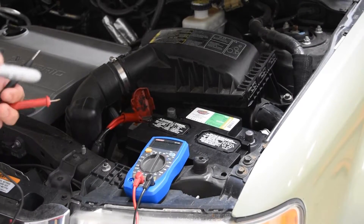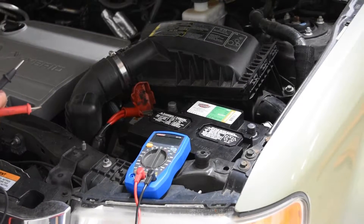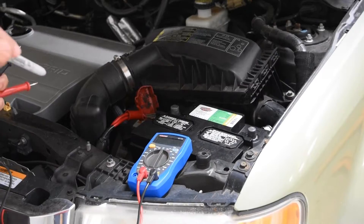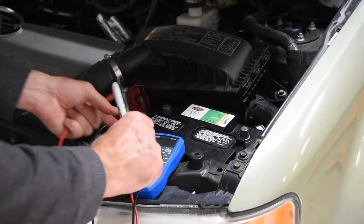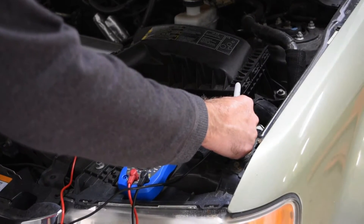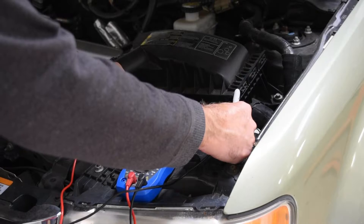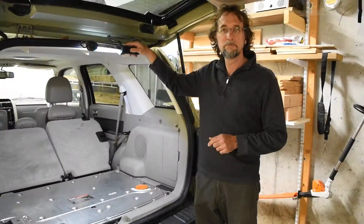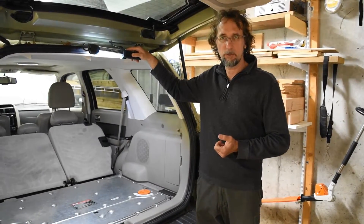It's a good idea to also check your battery that's in the engine compartment. This battery is not there to start the engine — it's just for the control units to get everything in the state that the engine can be started from the HV battery. Please disconnect the terminals before you do that, then just hook up a normal voltmeter and see what the voltage is. In this case we have 12.5, a little bit over 12.5 volts. It's not 100% where it should be, but it's good enough to run the control units. So we definitely want to hang the battery on a charger later on.